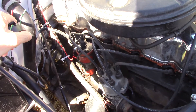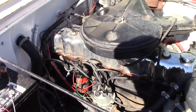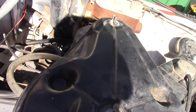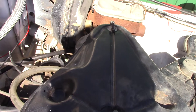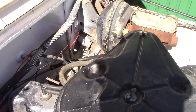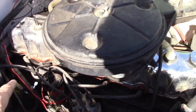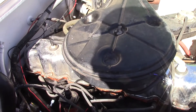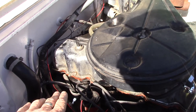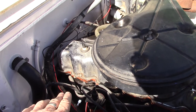I figured out one of my main problems — I didn't just have the tach sense wire screwed up here, I screwed it up over there when it came out of the Holley projection wiring harness. I reversed them over there, so I had the tach sense wire and the power wire reversed. It didn't matter what I did over here — I had them reversed over there. There's no excuse for that; this isn't something I'm not good at. I was pissed off, I was tired — it doesn't matter, I just screwed up and now I've got to fix it.